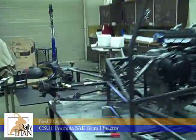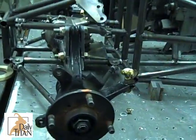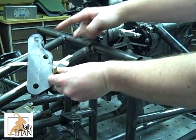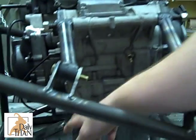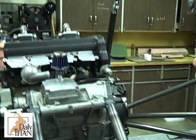We got the rear suspension on, axles cut and welded. All our adapters came in so we could run the Geo Metro uprights back here. All our hardware is coming in so we can start cutting our tie rods. We've got a solid rod running up here that's going to rock the suspension as it travels and rock the shock. Here are our engine mounts — fully mounted. Two removable bars here and solid mounts down here, and another solid mount on the back. It's not even fully welded but doesn't even move at all.